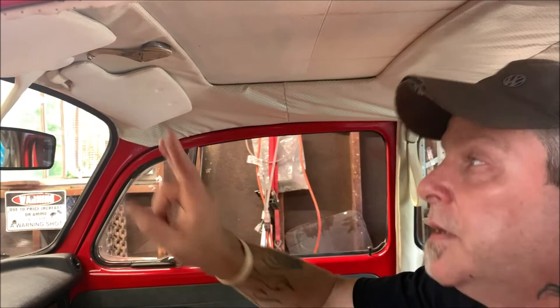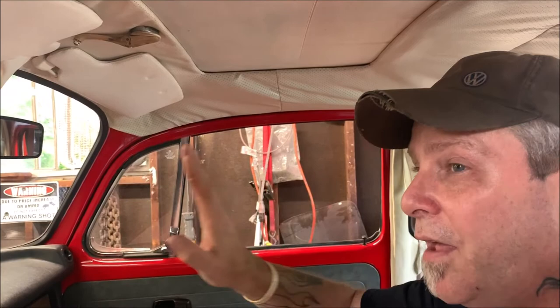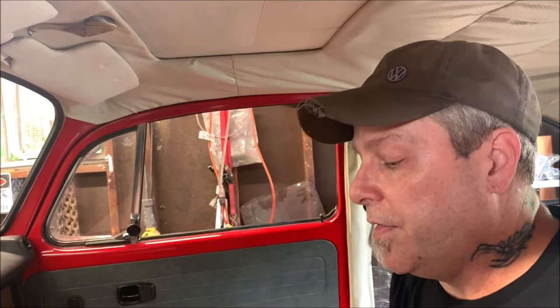Now you're going to tighten these screws up the whole way, and the gear will push up into the cables. It is completely adjusted. Now, if it's not, which is doubtful if you've followed this along, you can take it back apart and readjust again. But these adjusters that are on the back cables here will be about an inch from your ramps. They say in a factory service manual to put it up against the ramps. That didn't work for me. I was an inch back from the ramps.